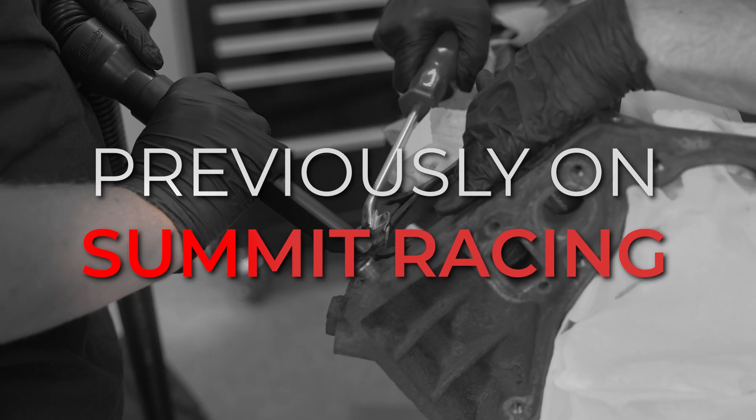We have to scrape the decks. So the next big step in our LS build was getting our cylinder heads. It was a set of junkyard 799s, but I wanted to clean them up a little bit to make sure they were going to seal well and work even better. So I brought them down here to Trick Flow Specialties to the custom porting shop, Total Engine Airflow. The guys gave me a nice beauty cut on them, and they also went ahead and installed my valve springs and got all the valve stuff figured out. So I just picked up the heads — they're nice, clean and brand new looking so we can get them thrown on top of our new LS.